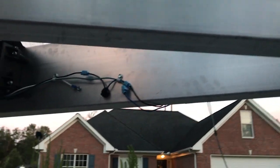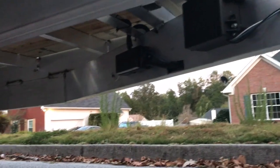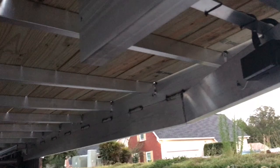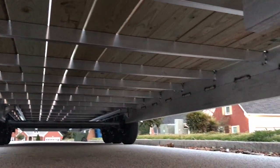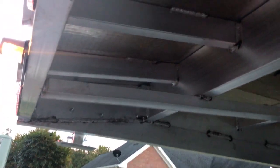Looking underneath, you can see the tongue has three two-by-seven inch pieces of aluminum tubing that run the full length of the trailer, with another stack of two-by-seven aluminum tubing on top making up the deck frame. Cross members are every 16 inches, and the axles have their own beam subframe system. At the dovetail you can see the aluminum tread plate and the gusseting — they cut one of the two-by-seven beams at an angle and angled down the top beam to meet it, which is supposedly a very strong way to do that rear section.